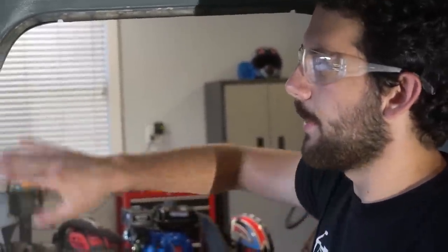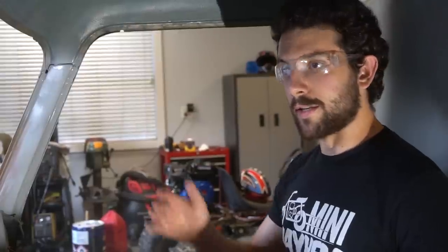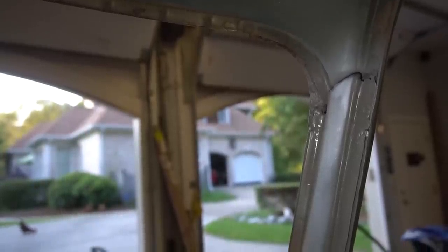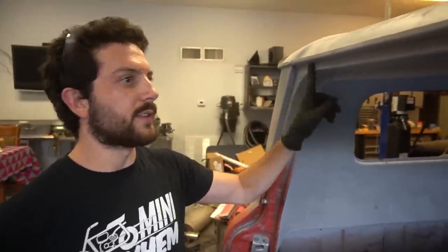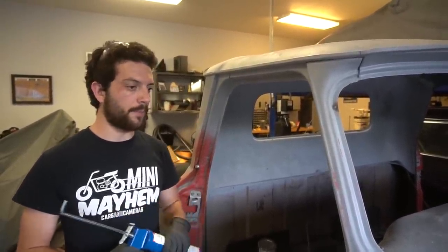It's not perfect, but I can always go back and touch it up with sandpaper. That's what I've found with body work — you do it, you think it's perfect, you paint it, you find out it's not perfect, you sand it some more, you paint it. It's just a process until it gets closer and closer to being perfect, but it's still never really perfect. These spots where you can clearly see the welding — not concerned about that, because that's where weather stripping is going to go. I'm going to use some seam sealer now. Honestly, I've never used this stuff before, but like how hard could it be? I already took a hamburger wheel to these seams and got the old seam sealer off. So I'm going to start on the firewall and just load it up — fill up all the holes with seam sealer, because that's about a hundred thousand times faster than cutting out the firewall and putting in a new one. I just want to enjoy the truck.